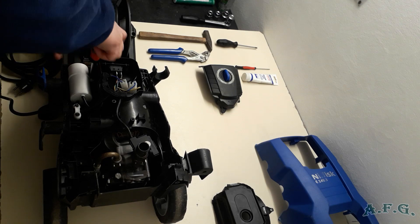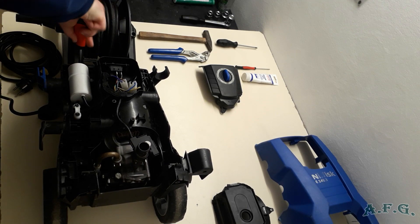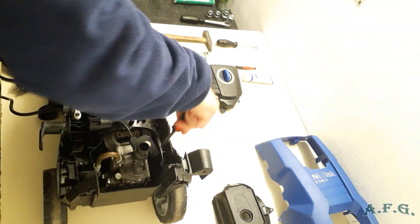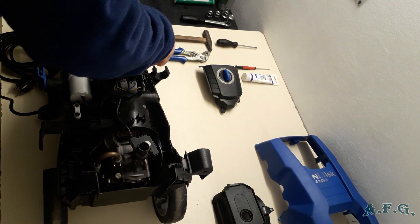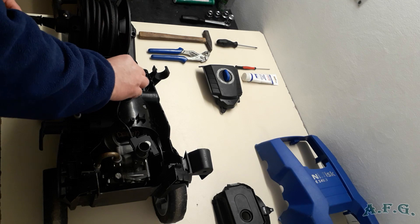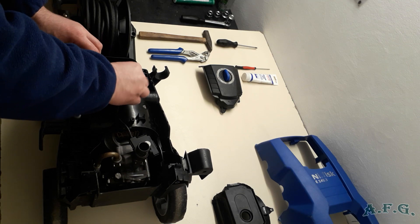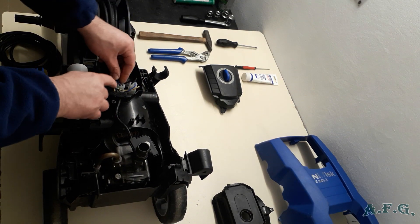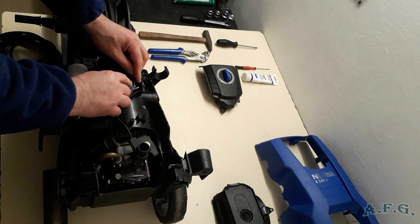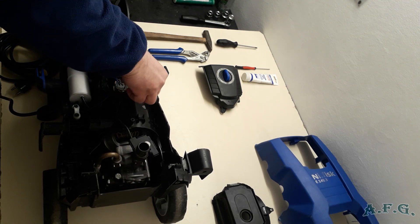And the last one. Okay, that's it. Now we can connect the wires. The capacitor has the brown and blue cables connected on the left-hand side — first the blue, then the brown. The micro switch is connected on the right side — first is the black and then the blue cable. Now we have it, and the last one is yellow and green.